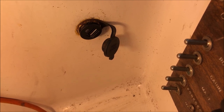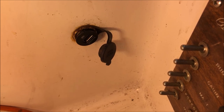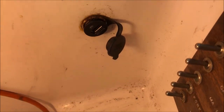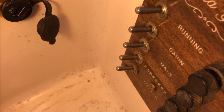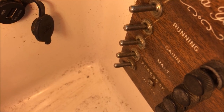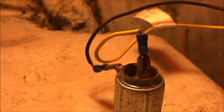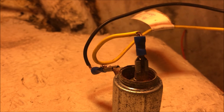What we'll do is unhook the hot side — the positive side — figure out where it goes to the old switch panel right there, and undo all that. We'll take it off the switch panel and put it on the auxiliary switch panel, which is mounted above the aft seat. So we're going to pull off the yellow wire — it's just on a spade connector — and disconnect that. I'm kind of looking upside down right now.